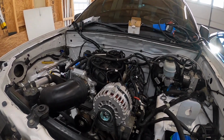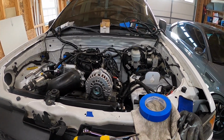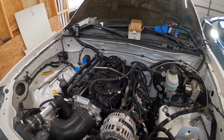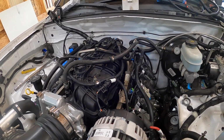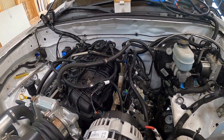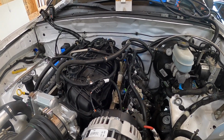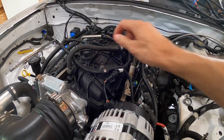I didn't talk about the brake booster yet, but I did finish this a few days ago. I won't spend much time on it. There's a few ways you can tackle this. The brake booster hose is a fairly good sized vacuum hose. The factory Colorado one is really goofy and won't really work, so you need something longer. I had some of this extra vacuum hose laying around.